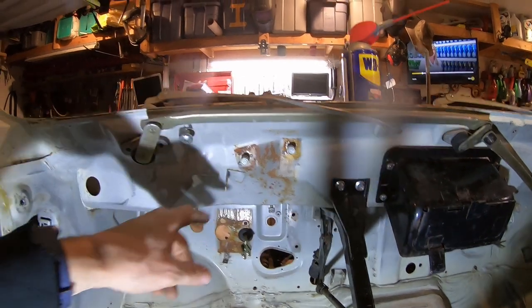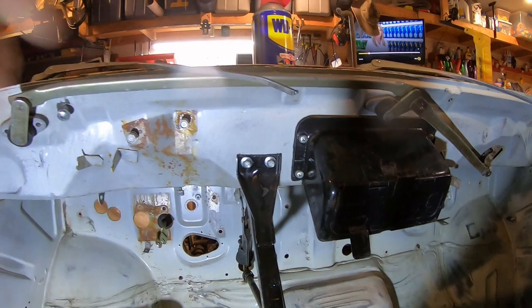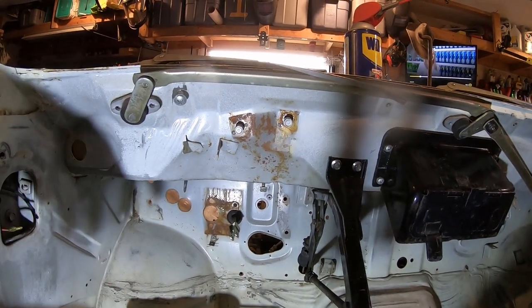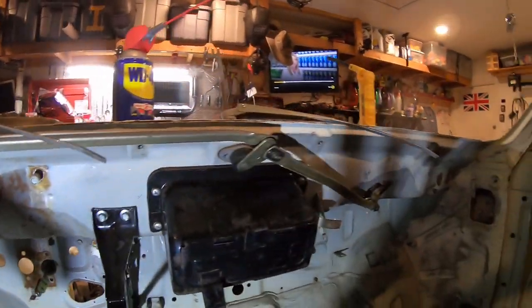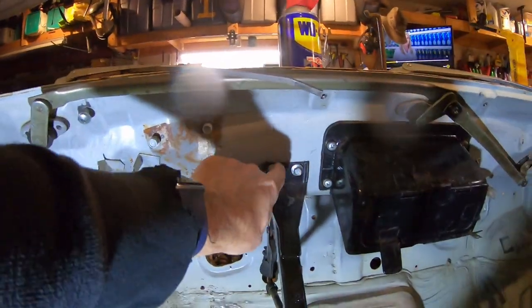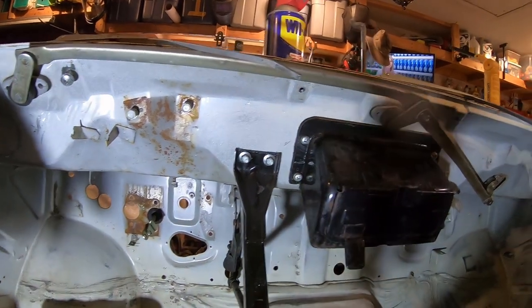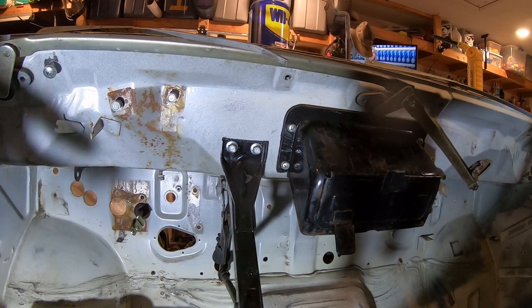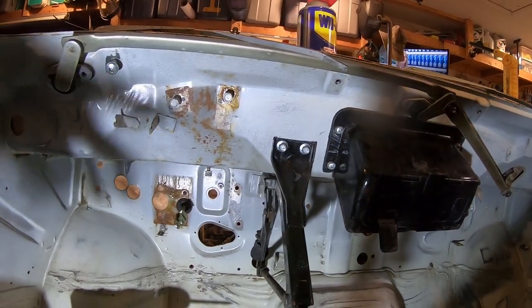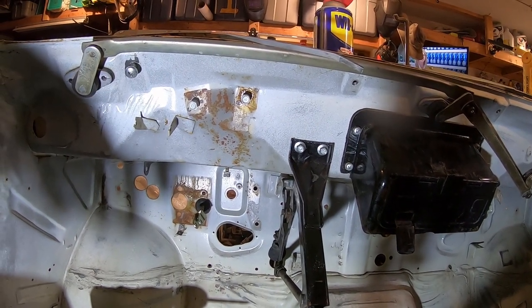Same as this size. I think these are 1/4 by 20 also. Parking brake was busted. So I went ahead and drilled them out to 8mm. Retapped them to 8 by 1.25. It's a little bit bigger. And it seems to work good. So now all 6 top bolts and the 2 parking brakes are all 8mm. More common size. Easier to find. Bigger, stronger. Most of this truck is metric, I guess, on the drivetrain, and all the new stuff I'm going to put in is metric, like, you know, the modern brakes and stuff.